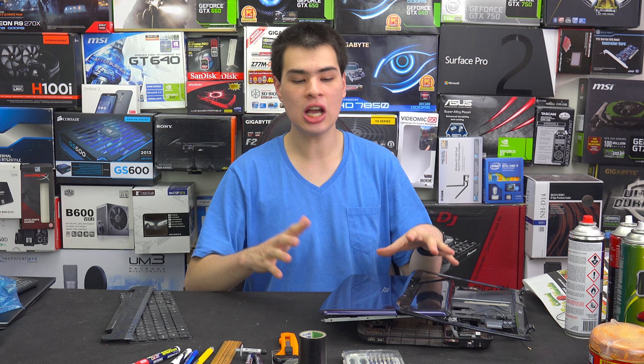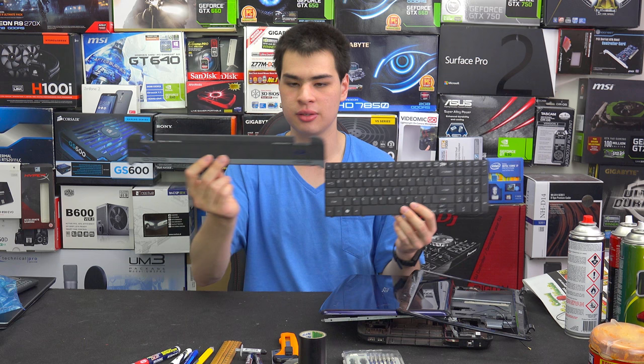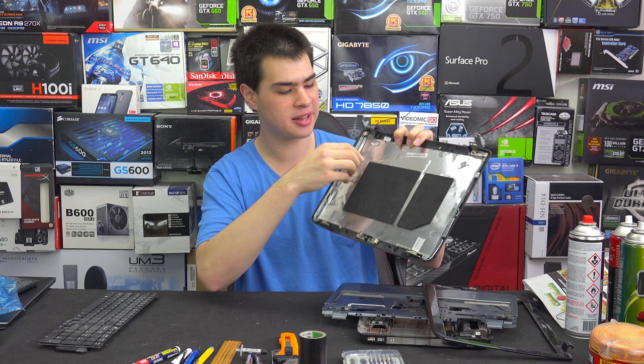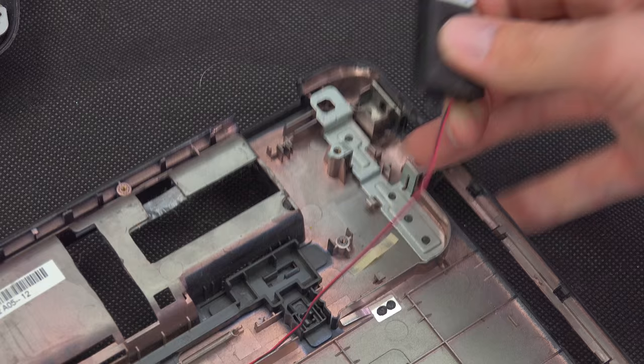At this point our computer should look like a pile of bits of plastic or metal, depending on your laptop. We need to figure out what we're painting and what we're not. For this project, we're not going to be painting the keyboard, and we're also not going to paint the little trim piece at the top because it has holes for speakers. We also need to remove any logos, feet, pads, and any WiFi antennas, as a lot of notebooks have rubber pads and antennas in the lid. We want to remove any electronic PCBs to avoid damaging them.